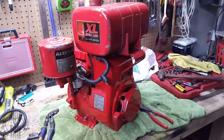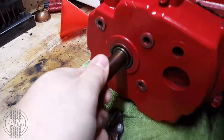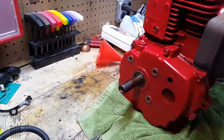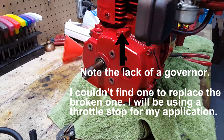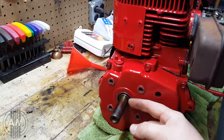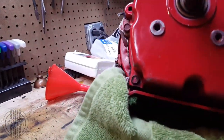It's the next day. I was able to get everything reassembled with new fuel line and air filters, and I put SAE 30 in. One concern I have is there's a little bit of end play — a little more than what should be. When I look it up, it should be between 1 and 3 thou, but this is like 30 thou. It is what it is. I did have to take the gasket out to give me a little more tolerance to tighten it up a bit. Right now I just have RTV in there, but I just filled it with oil and I don't see any leaks. Let's go fire it up.